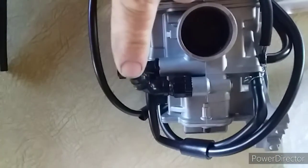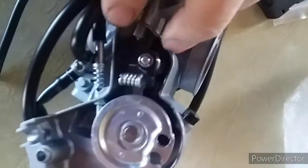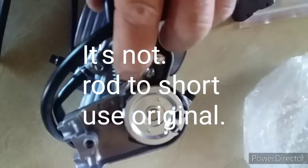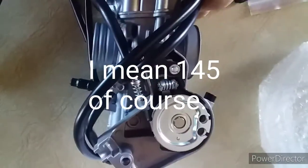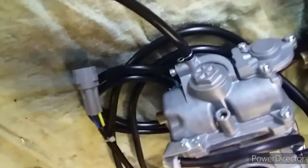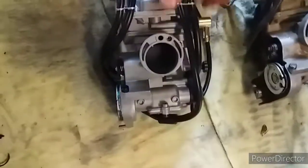It's got a new piece for the hot starter but I think I'll just put the old hot starter straight in. They're not cheap to buy by themselves. It'll be interesting to see where the accelerator pump timing is set up. I'll probably have to put the standard O-ring mod in there. I reckon I'm just going to whack the jet straight in there out of the other one. Side by side visuals — the first thing I'm noticing is there's a longer casting over the mixture screw here. Not necessarily a bad thing — it might actually guide your screwdriver on there if you don't want to get one of those thumbscrew or flexi ones. No obvious differences yet, I'll do some measuring in a minute.